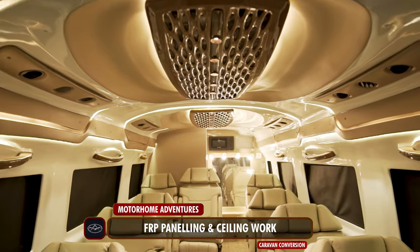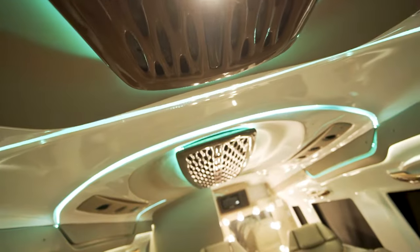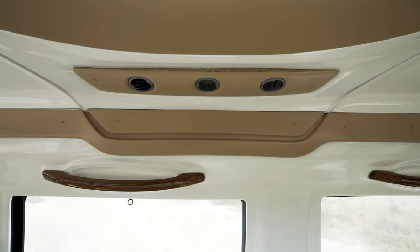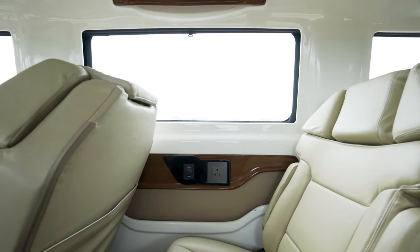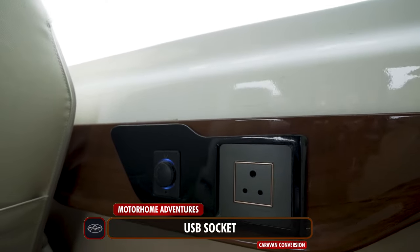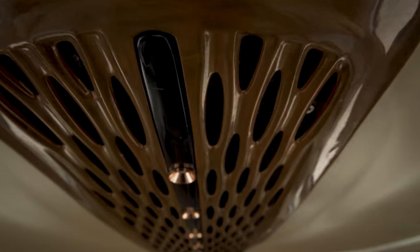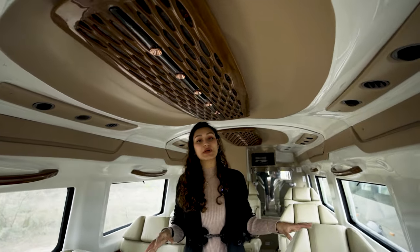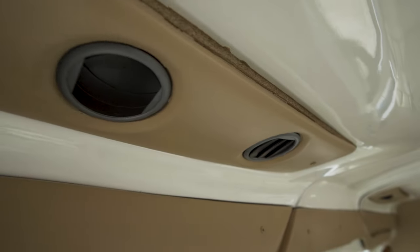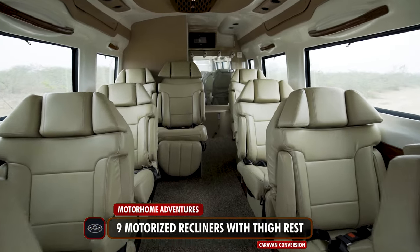On the top we have the FRP ceiling. Along with our bathrooms, FRP paneling is one of our USPs — it is lightweight, all-weather friendly, and easy to maintain. We have pockets created for LED lights and storage of knickknacks, sockets on each seat, and grab handles. For the AC, the client requested a pre-bought auto AC rather than our static ACs, so these are the vents for that along with the suction vent, customized through the fiber design with spotlights.